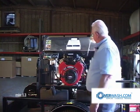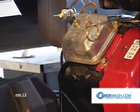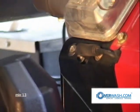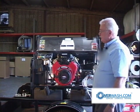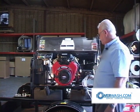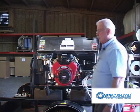Your spark plugs are located on either side of your engine, here and here. To change your spark plugs, never do it when the engine's hot. You probably don't need to do it more than once or twice a year. If you check your manual, you'll find the gap for that spark plug is 30 thousandths. Remove the spark plug, gap your new spark plug, insert it, and do not over-tighten.